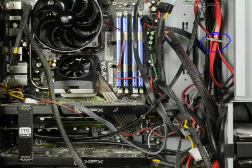Okay, usually you'll have a few of those laying around from previous projects or something like that, and just put it inside of the bag. Don't lay it on top of the bag because that doesn't actually protect it. You see, an ESD bag is designed so that if you touch it, yeah, static might discharge from you, but it's designed so that it will not penetrate through the bag and onto some of the sensitive electronic components. If you just put this on top of the bag, then you could still accidentally touch it and still damage something.